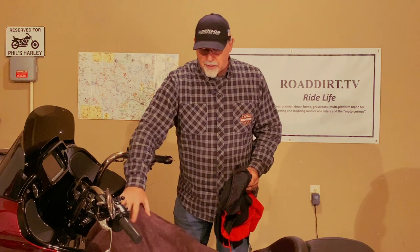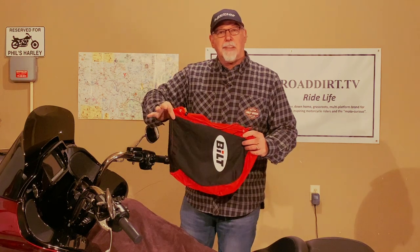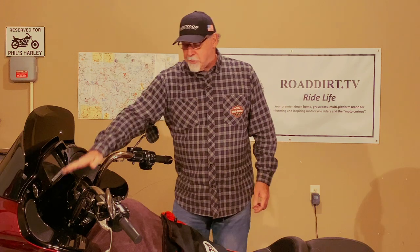So no more talking — let's get into the nuts and bolts. Before I get started, it's very important when you begin a project like this that you take some covering — a rag or something — and cover the gas tanks so you don't scratch them. We're going to remove the hydraulics and place them inside a bag. I'm using helmet bags for that. Then we'll remove the hydraulics with a Torx 25, work on the instrumentation cap and switch housings, unplug the electronics, take the bars off, remove the grips and throttle, then install the wiring into the new bars.